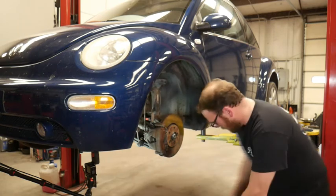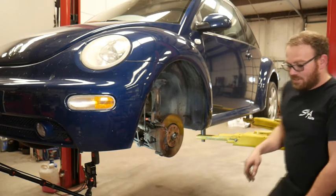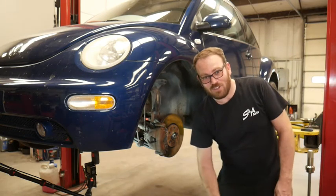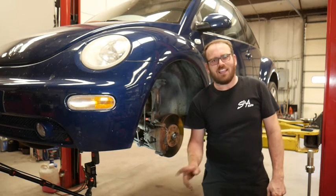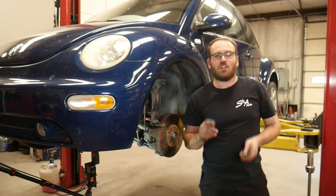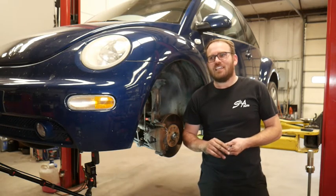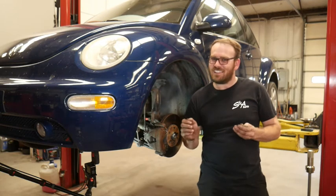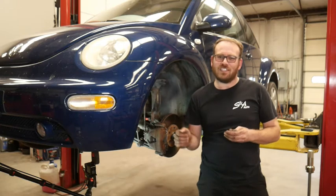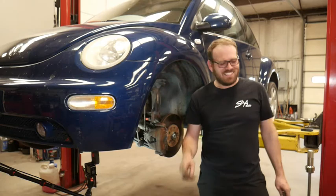Pico, that is why we torque the drain plug at the shop. Everyone's snug is different, but 30 foot-pounds is 30 foot-pounds. Unfortunately, I did give him a torque wrench, and that vehicle called for 18 foot-pounds. I don't know why it was different than my Highlander. My Highlander was 30 foot-pounds. Gave him a torque wrench set to 18 foot-pounds. I don't think he knew how to use a torque wrench. Or at 18 foot-pounds, the torque wrench doesn't click that hard, so he probably never heard or felt it click, and he just kept turning. And since he had a ratchet this long, it just pulled the threads right out.